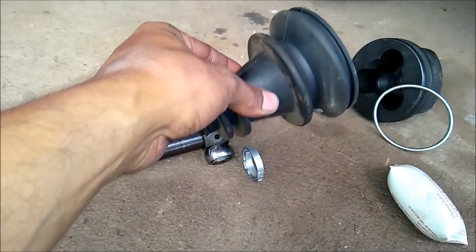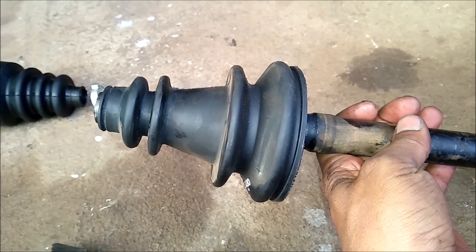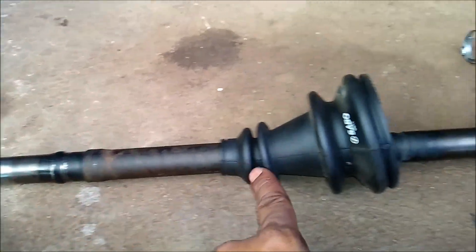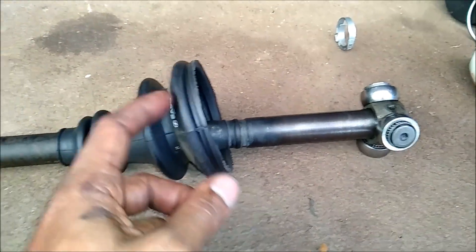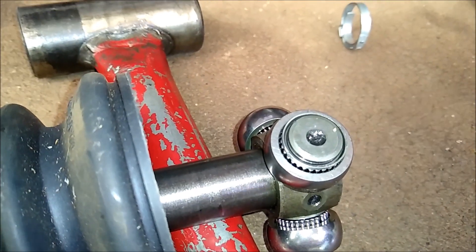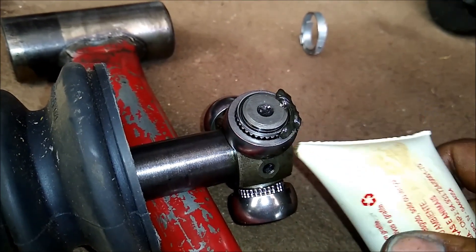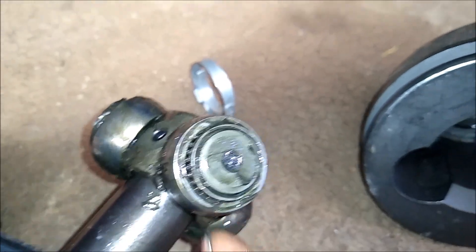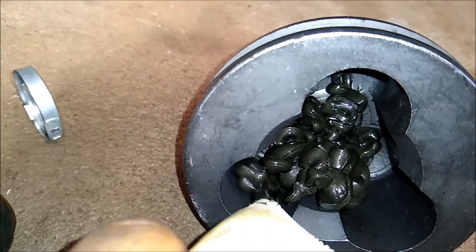So the first thing is to take this boot here and slide it through here and place it here. Be careful when sliding it through — don't tear the boot before installing it. Here I need to add a little bit of grease — I think it's even better, but be careful not to tear it. Now let's grease these teeth here — can you see? Grease everything. So I've applied grease here — can you see? There's grease inside. Now let's grease inside the tulip as well — lots of grease. Too much grease doesn't cause problems, you can apply it.